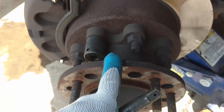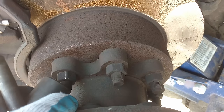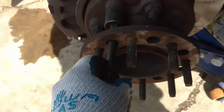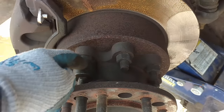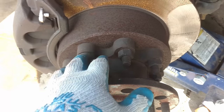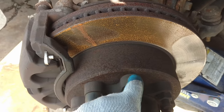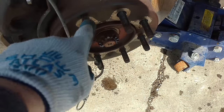First step for me is to take this adapter off. See these nuts back here that hold this on — it's 22 millimeter. The way this is set up, you put your socket on there, run your extension through that hole, and then you can break them all loose. You obviously have to take the socket off before you go too far or you'll be jammed in there and can't get it out. Once you take this off, you take the caliper off next, and then this rotor comes off. The rotor is sandwiched between the hub and the bearing — that's what's holding it on.